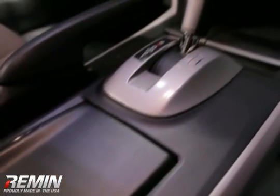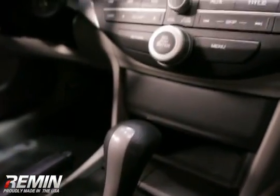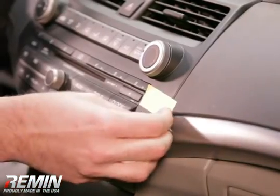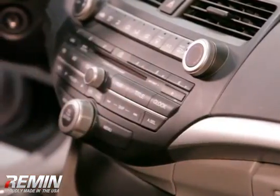Word of caution. Vehicles that have been treated with vinyl treatments need to be thoroughly cleaned until the surface area is dull in appearance. There is no feel of residue. Special care should be taken with any used vehicles. Once you think it's clean enough, you can test it with a piece of masking tape in order to see if it will stick. If it sticks, move on to step 3.